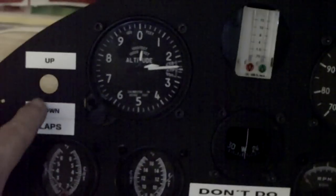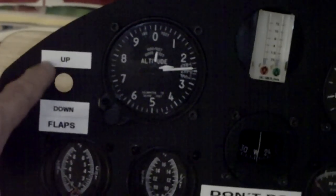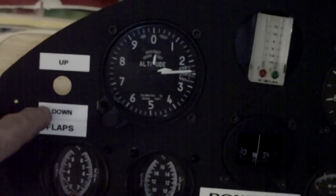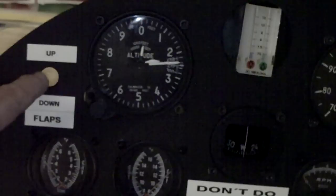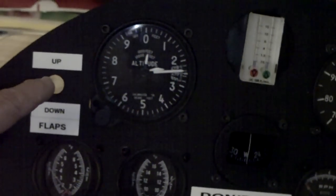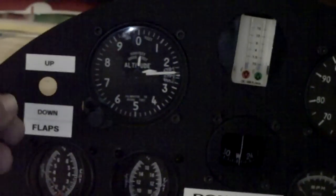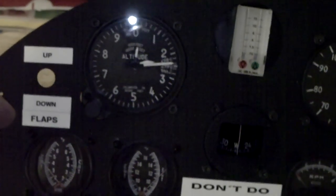I have a placard here for my flaps, which I haven't mounted the switch yet - it is here. So it will be indicated for flaps up and flaps down. The interesting thing is that the switch is spring-loaded to the down position and will go back to neutral or off because of the spring, and then you have to pull up and push up to get the flaps up - manually engage it.